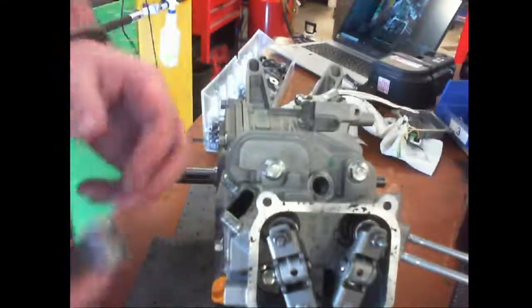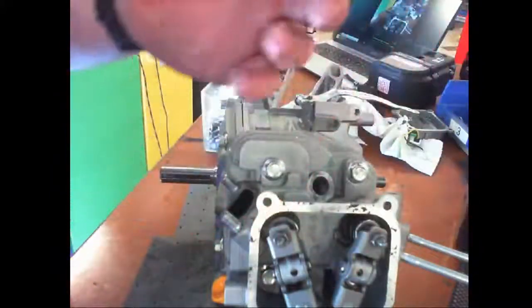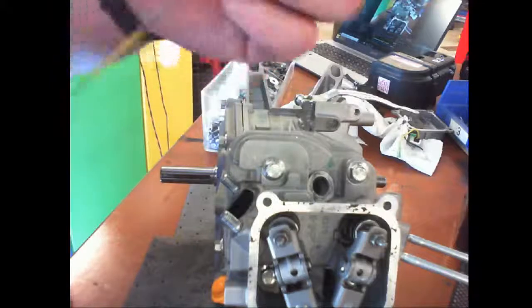What we want on a feeler gauge, you want to be able to pinch this and pull. You should be able to feel that basic resistance, not where I'm fighting it. That's hence its name, feeler gauge. You're feeling the measurement. And the odd part is everybody will feel it differently, so you have to be aware of that.